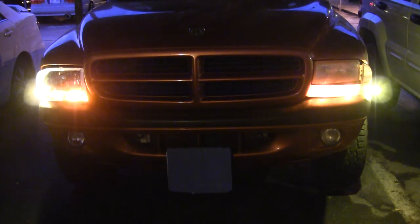The reason I'm doing this is to see what the light output is of the factory lamps with lenses versus the clear aftermarket on the right-hand side. That requires amber lights, because the factory lights are white behind amber lenses. When I bought the clear ones, I had to purchase amber lights, because according to law you cannot have flashing white lights to the front of a vehicle unless you're an emergency vehicle. That's why they make switchback lights that emit white in LED mode and switch to amber for the turn signal — amber flashing lights are legal, but not other colors.